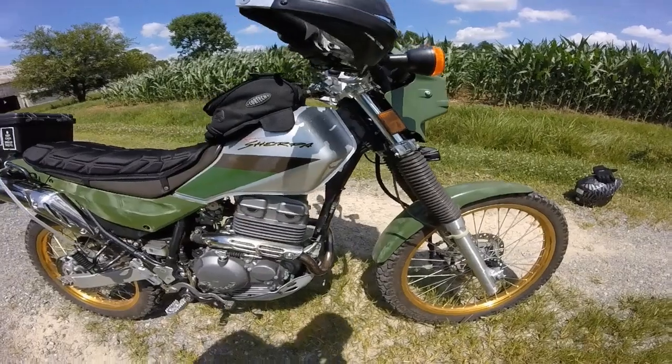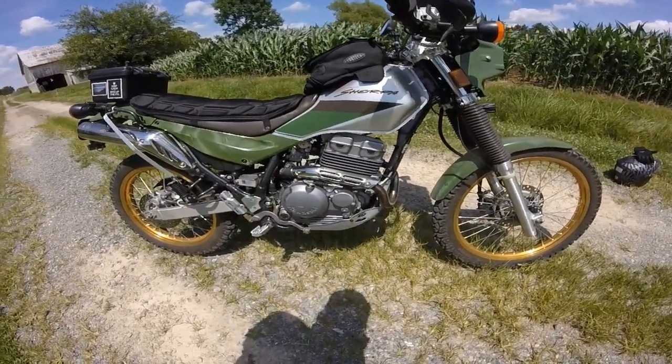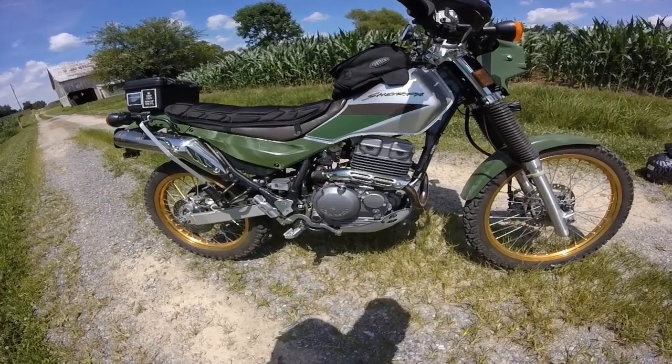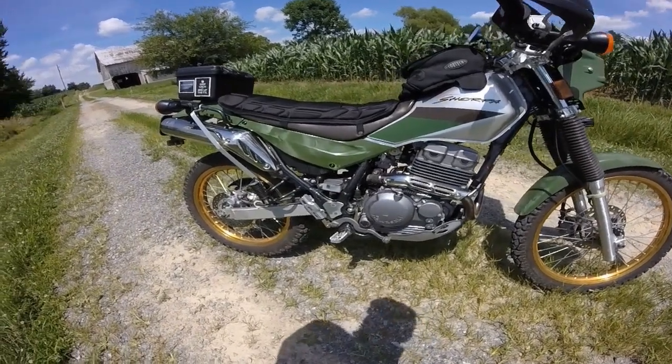My right exhaust was super tight — none of my other gauges would go through — but the other three were fine. They actually were pretty good, well within spec and range.